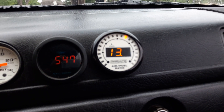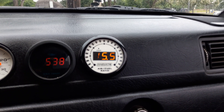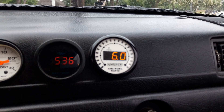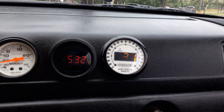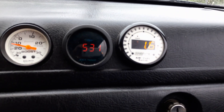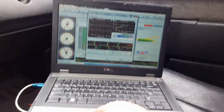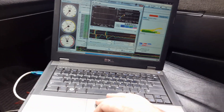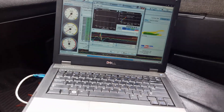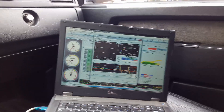Right here it's telling us that it's rich when I hit the throttle — it goes rich instead of lean. I usually see like 12 and then 10 — 10.0 is rich. It's varying so I'm not sure, maybe I have something awry. Yeah, it's way rich, so we'll come back down with that.